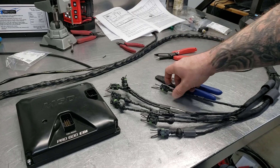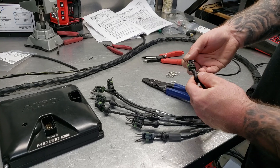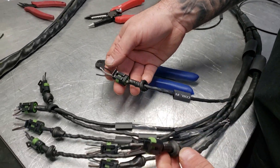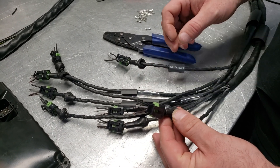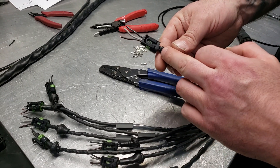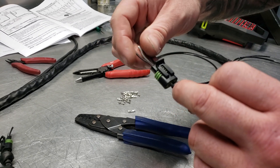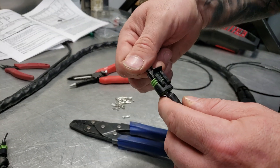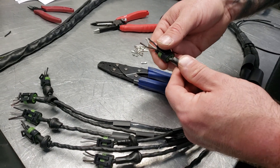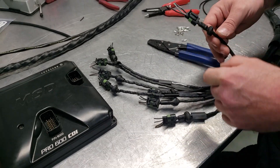What I wanted to show you is that you have to shove them through first. If you're going to make a sealed harness like I typically do, I use these little RB390 boots, and you're going to have to leave yourself about two and a half to three inches of exposed wire. If you look from here to here, it's about two and a half inches — you'll leave that much exposed wire and then cover it up with your RB390 boot. Or you'll just leave it open and not cover it.